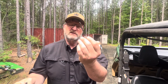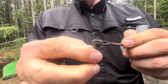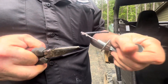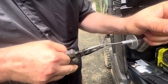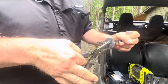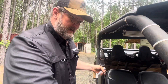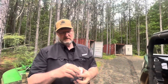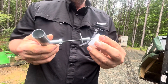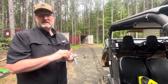This is your plug inserter tool. We're going to force the plug in between the prongs — like threading a needle. You want to get it where it's about in the center. I didn't do this on the reamer and I should have: I should have put a little bit of grease on there. We're just going to put a little grease in there so it'll penetrate through the tire easier. I should have done that on the reamer — I skipped that step.